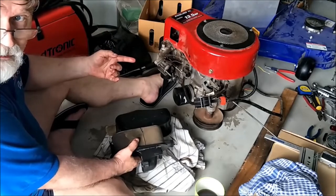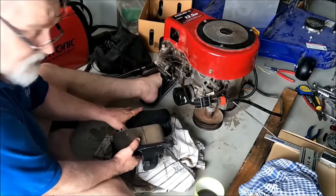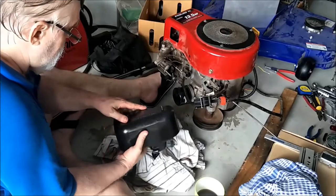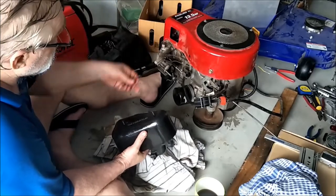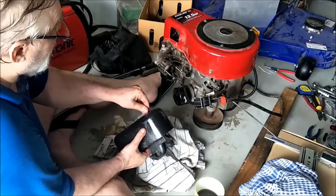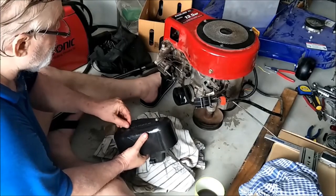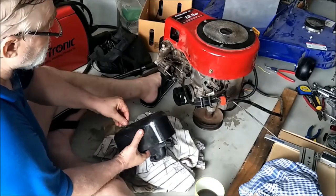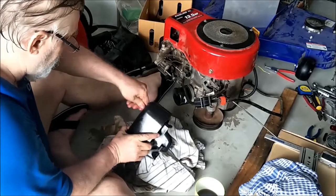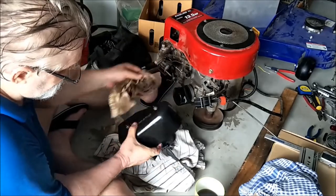there is a good chance, if it's been like that for a real long time, that between the ring gap or any gap, just sitting there like that, it could possibly have gotten up to the cylinder. So you had a shitload of oil up in the cylinder. That explains why it was hard to turn over, because obviously it's trying to compress oil in the cylinder, and why it was hard to fire. All of those things add up. I reckon he must have had the thing sat on its side for a very long time.